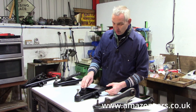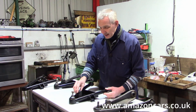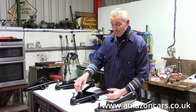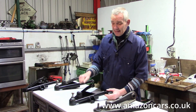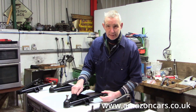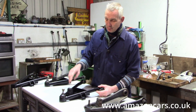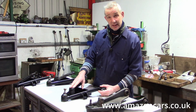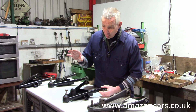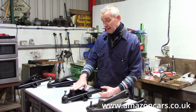I've gone for the stock bump stop. We were using the uprated polyurethane bump stops on Amy's car, but in my opinion they're too hard and too rapid acting. I would rather have this softer one that reacts more steadily — comes on a little bit earlier but then compresses more gradually.